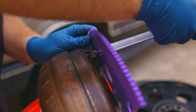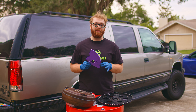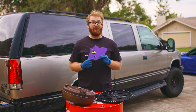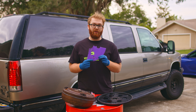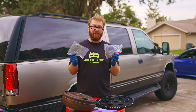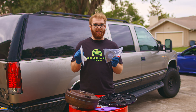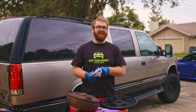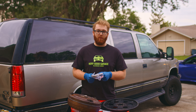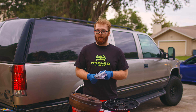To get this gap to the correct tolerances, you might need to shim the flex plate in a couple of different ways. The way we shimmed our flex plate last time is that we used washers between the flex plate and the torque converter. I don't know if this is the best way to do it, but we're going to take a different approach this time and shim it from the crank to the flex plate, using something like these shim kits. This set is three of the same size shims at 90 thousandths of an inch, and this one is an assortment. In the last video, when we installed the washer shims, we ended up needing something like 153 thousandths to 214 thousandths of an inch, and we ended up getting pretty right down the middle of that with a set of washers.